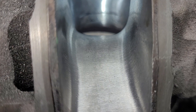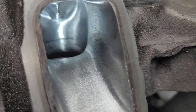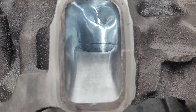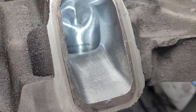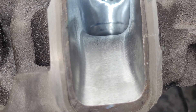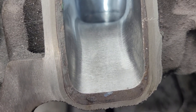Good to keep in mind, right? I was working on the floor first — it took a ridiculous amount of time to get the floor decent, and the rest of it I didn't take as much time. It looks relatively pretty, but I'm not a big fan of pretty. Pretty doesn't make high performance, doesn't make power. Remember, if you've got fuel rolling in here, that is not going to help break up the fuel. Take a look at your windshield when you're driving down the highway in the rain — that's what the fuel is going to do, and that's not what you want.